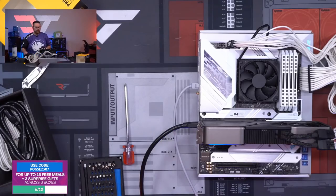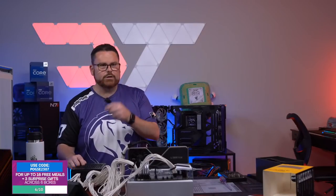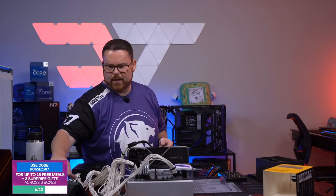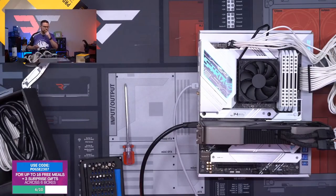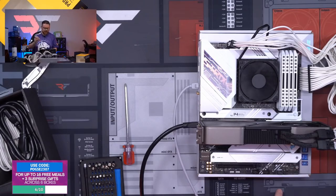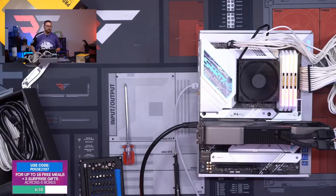Okay, so what we're gonna do now is I'm going to turn the PSU on. Like this. They might be saying, hey, Robey, there's no power button. You're gonna go top down. So there's a power plus and minus switch right over here. So you're just gonna basically complete that circuit with your screwdriver. Just like that. And now our PC is on. Now we wait. Just make sure that we actually get a signal and that we are booted. And this is an important step for water cooling because you do not want to try and solve this after you've water cooled and done all of the work. You know what I mean?